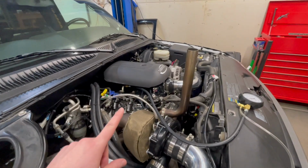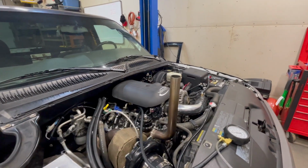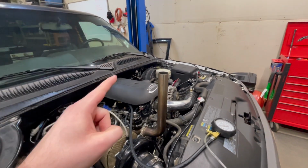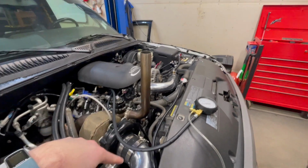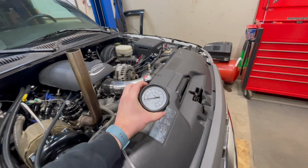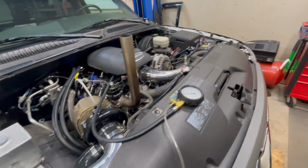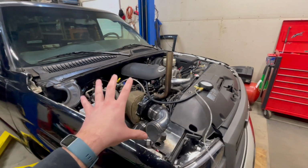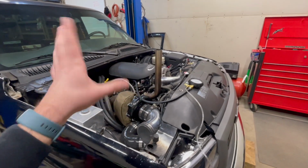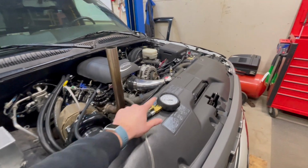One thing I want to make sure is that's an on-3 performance fuel pressure regulator and gauge. And I just want to confirm that it is somewhat accurate. So we're going to use the most accurate thing money can buy, which is the Harbor Freight fuel pressure tester. And we're just going to see if we got a little discrepancy between the two, or if they're kind of close. And I would say that they're both mostly accurate. This has been used before and shown accurate.